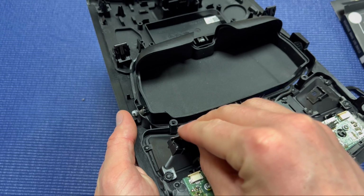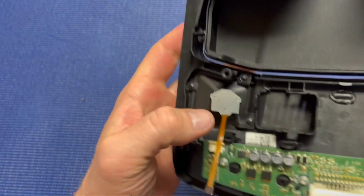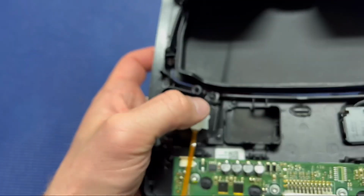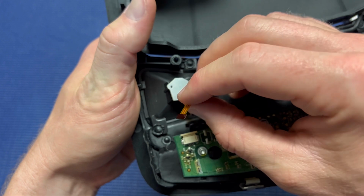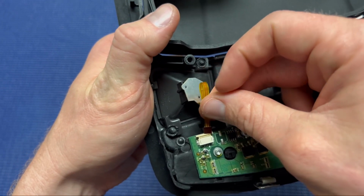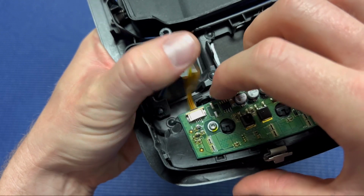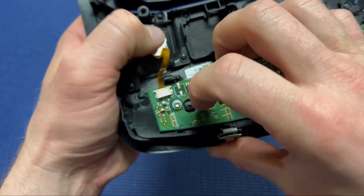Alright, so if you still have a few of those pins, like I did, like I had 2 of those pins, so I just kind of pressed it back onto the pin, and I'm using the 3M tape to really just hold it together. This tape is really strong. It's not going anywhere. So just kind of hold it down there for, I'd say, a solid 30 seconds to let it adhere to the plastic. And also just make sure you got the right side facing down. There's a shiny side and there's a matte side. Just make sure the shiny side is facing down towards the motherboard, and then close up that little door right there and you should be good to go.